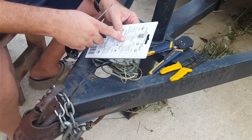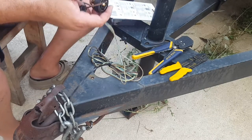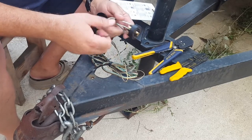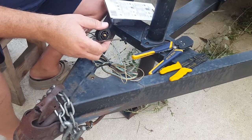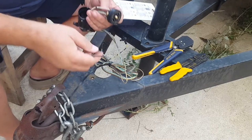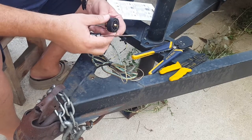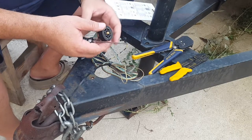Your brown is your right stoplight, so make sure you put your green in the brown. Your yellow is center auxiliary — I don't have any auxiliary, it's just like a network cable. There's a standard for a reason, but if you happen to mess up and put your brown and green in the wrong jack hole, as long as you do the other end the same way, you're fine. That's all the adapter does — it crosses the wires where they're supposed to be, so when you turn the turn signal on, the brake lights don't come on but the left signal does.